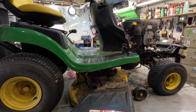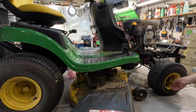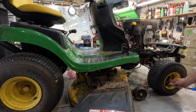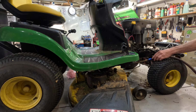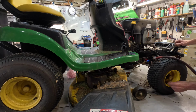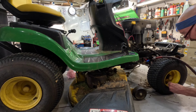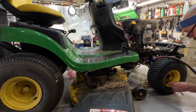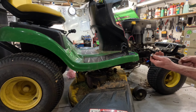I'm going to go ahead and put some air in that right front tire. I'm going to let it sit here for another day or two. I want to see how fast this thing leaks because we may end up putting a tube in it for him. Alright, let me grab the gauge. I want to see how many pounds that is. We'll gauge the rate of deflation. That's 25. Let me let it out. Put about 20 in it and see how it acts. That is right on 20.